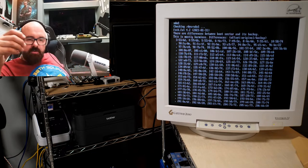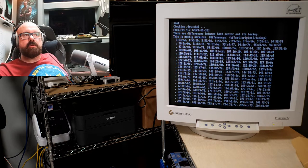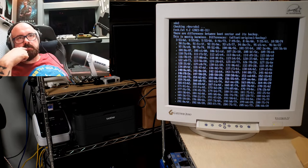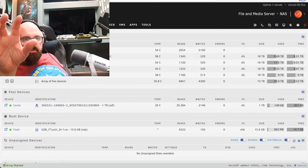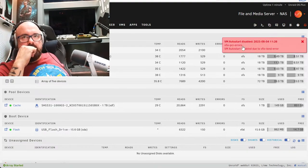I've lost you, Bob. I can't hear you at the moment. Oh, yep. Sorry. I turned my mic down to be less echoey, but okay, that actually does make perfect sense. And while I knew what a VBIOS was, I had no idea what we were going to do in context of this, but you just explained it perfectly. So you see, what's happened now is we're not seeing any more writing on the screen because we bound the graphics card to VFIO. So that's why we're not seeing it finishing the boot on the monitor. Okay, and I wonder if that's why we still got that error here too. So, all right, walk me through what you think.